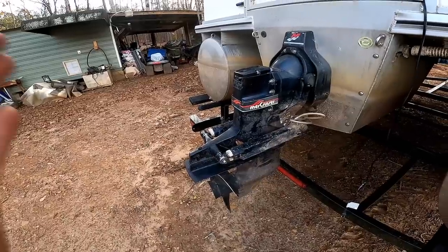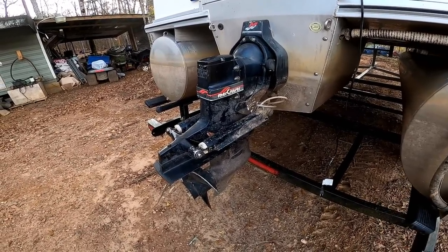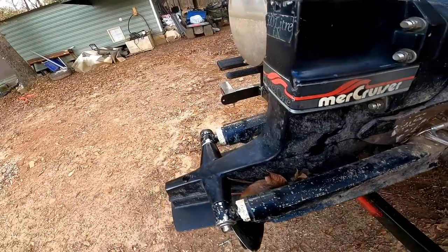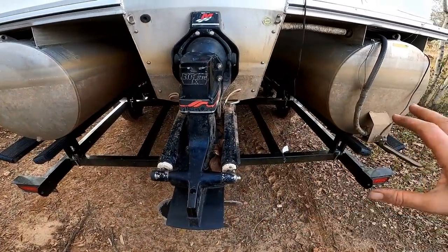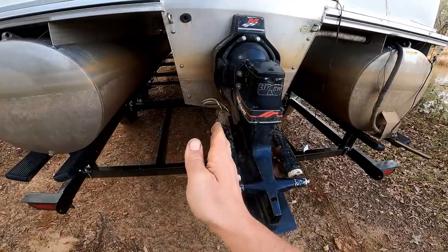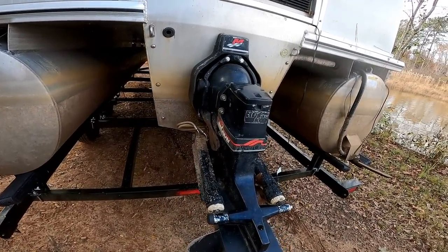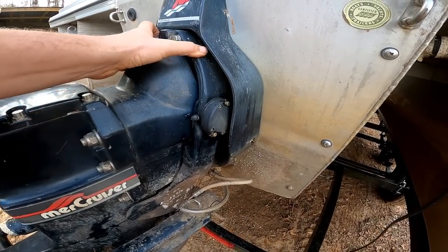So the owner of this boat was driving down the water and I guess he hit a huge stump in the water, and now whenever he tries to steer it, it'll steer all the way this way, but it will only steer to maybe about right here on this side. So I'm guessing the gimbal housing is bent in here,